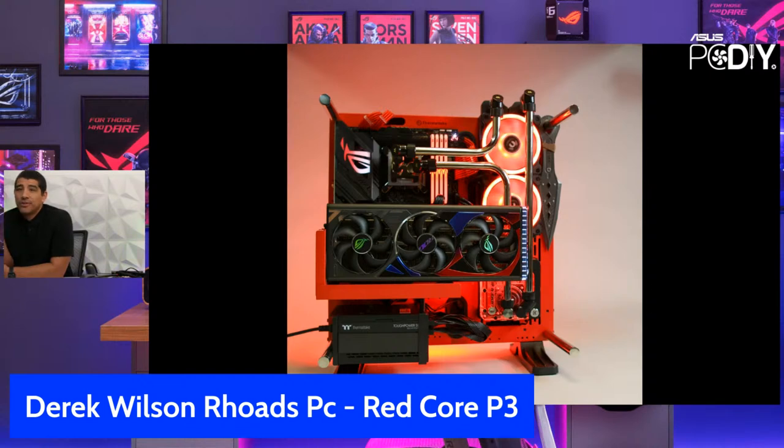And you know, you're not going to be running that with a four DIMM configuration, regardless of whether it's single rank or whether it's dual rank. He's going to be running single rank memory if it's only 64 gigabytes. So you might be able to get a little bit more aggressive, but you're definitely not going to be running at the higher frequency range. So that, my personal opinion, I would have gone with only a 2 DIMM, but I can understand from an aesthetic perspective why you go with the 4 DIMM config.